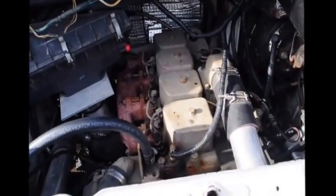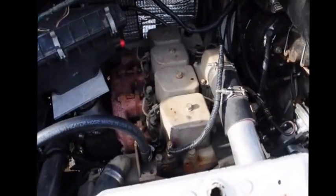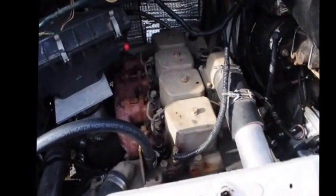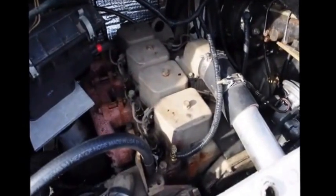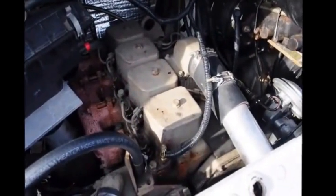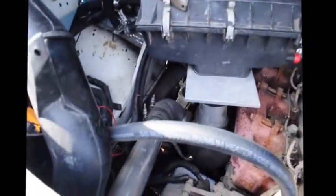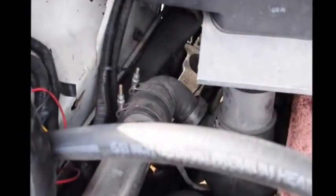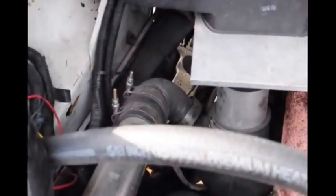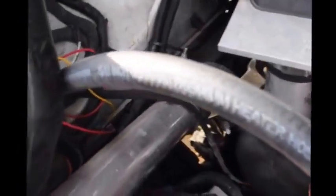A short video to show the 4BT Cummins diesel in the RV. In order to make this actually fit, I had to put in a sister frame. The frame runs along the side of the actual Lachero frame and brings down an area where I mount a Crown Victoria front suspension. The motor itself is mounted towards the front.